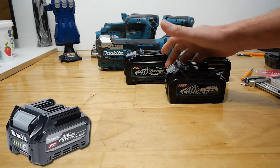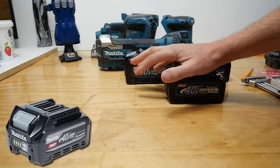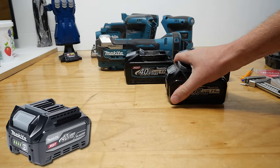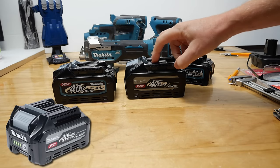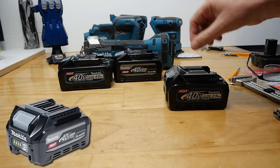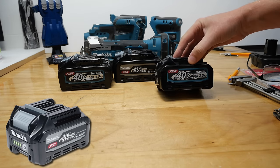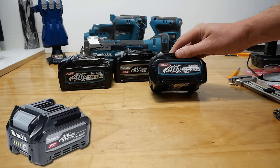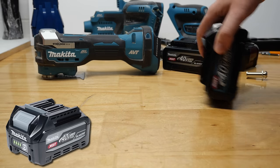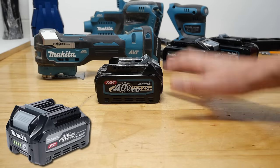That's not a bad thing. The tabless cells that are in this battery are awesome — they run much cooler than the others. So it's still a massive step up. The tabless cells might even be better than pouch cells anyway. Both are fairly new tech in tool batteries, so it'll take a while before we know if there are any failures from use over time. And this battery with tabless cells ended up being 70 grams lighter than the original. So the 50 gram difference between this and the new 2.5 amp hour battery fits pretty much perfectly with just the weight reduction of the new tabless cells.